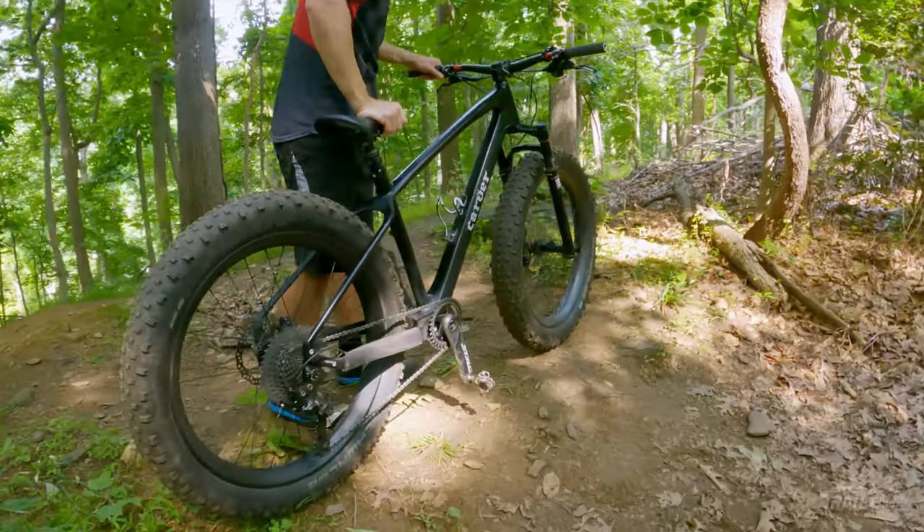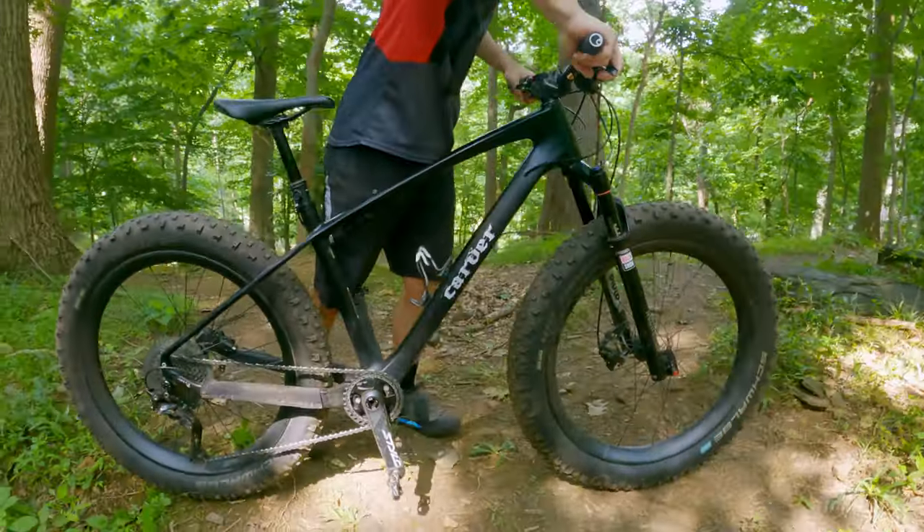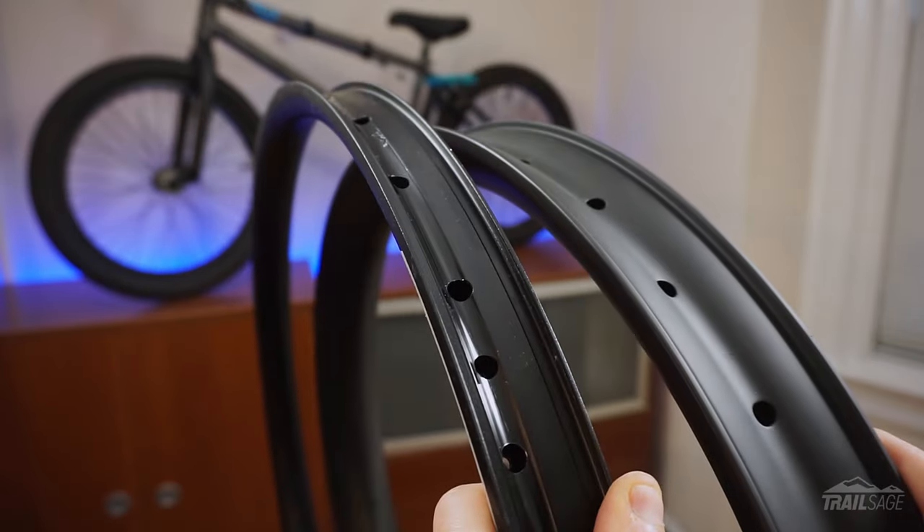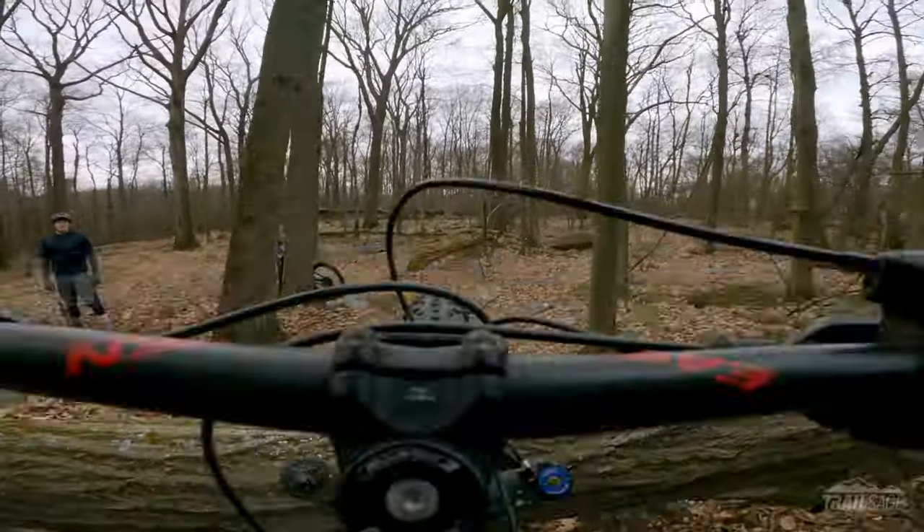Now that you know the specs, let's go into my likes. There are three things you can do to your fat bike to drastically change your ride: one, adding a dropper; two, adding front suspension; and three, upgrading your wheels. Without changing your hubs or tires, you can replace your existing rim with the NexT carbon rim, run it tubeless, and instantly drop a couple pounds. Just to give you a comparison, this fat bike rim is nearly twice the width and depth of a standard aluminum rim but nearly the same weight — and that's just insane. Anytime you can lose rolling weight, you'll notice a drastic difference in your ride quality. It'll pick up speed faster and make the bike more nimble. I realize nimble and fat bike are two words you don't hear together often, but it's true.